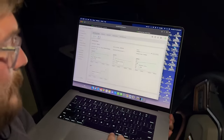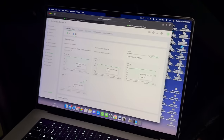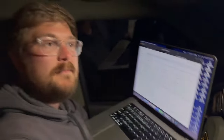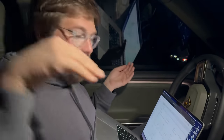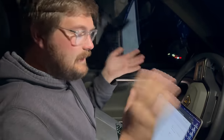But now, of course, the pack voltage comes up pretty quick. You're all the way up at 550 now. And that happened within only 4%. It can really damage a lithium cell when they're that low. They put bottom voltage protections in there, but they basically will just run away to zero. And if you get them too low, it could be damaged for a long time. Something like this actually doesn't really hurt the cell all that much.